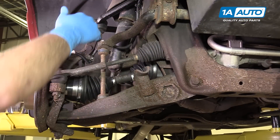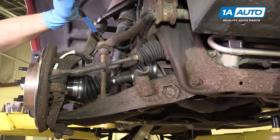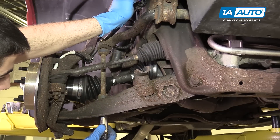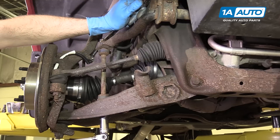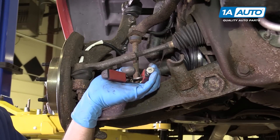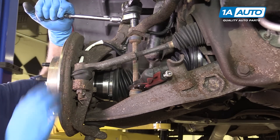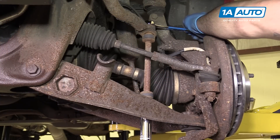Remove the wheel from the vehicle. To remove the sway bar link, there's a long bolt that runs all the way through this style link. We'll put the appropriate size wrench on the top — ours is a 16, yours may be different — and rotate it to brace it against the frame, because these tend to get pretty rusty and tough to remove. With the wrench braced against the frame, we'll get the appropriate socket, in this case an 18, and a breaker bar. Put it on the bottom nut which is under the control arm. It's very likely that yours is just going to break like ours did. Another method you can try is getting a pair of locking pliers onto the sleeve, bracing it against the control arm, and trying to twist off the bolt at the top. Repeat the steps to either break or remove the bolt on the opposite side.